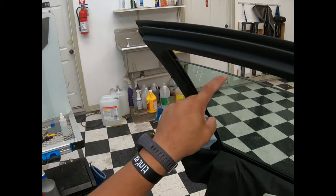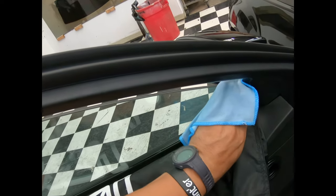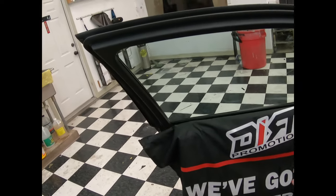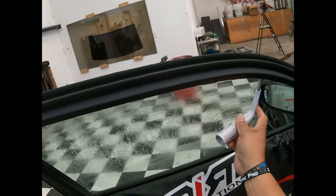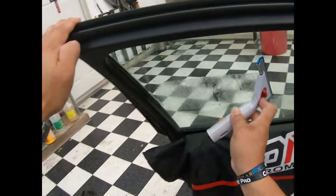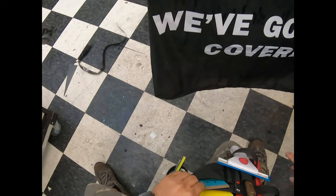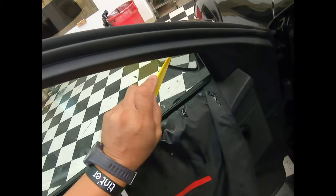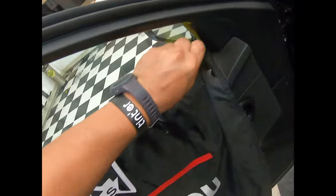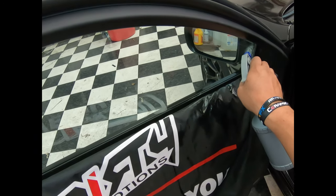These glasses are laminated, so there's a lot of dirt that sits there. Be sure to roll it all the time and just one pass. On this vehicle, I didn't tape up the sides because when I'm able to bottom load it, I'm really able to control where the film goes. When I two-stage — which is going to be on that door — I have no control where the film goes. It's going to perhaps touch sides, and that's the reason for that one being taped up, and this one was not.